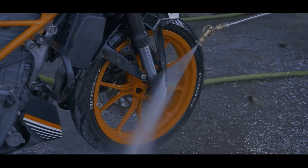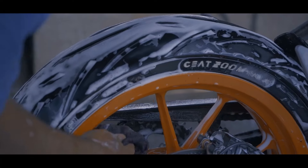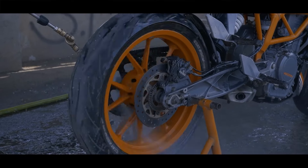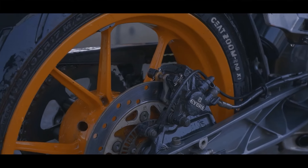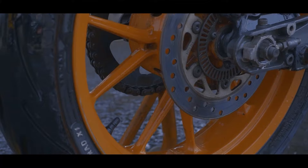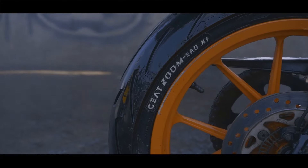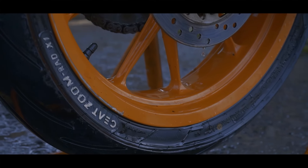Lastly, while taking the motorcycle to get cleaned up, we should also get the tyres scrubbed gently and washed. This helps remove residues such as sand, dirt or pollutants from the tyres. After the soap solution is washed off, carefully inspect the wet tyres. This will easily reveal cracks, punctures or bumps on the tyre surface. If there are any leaks, you'll notice bubbles as the air tries to escape.